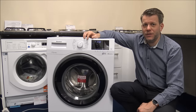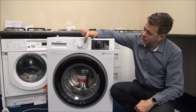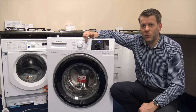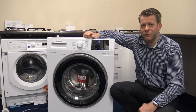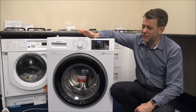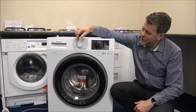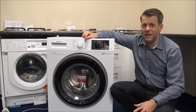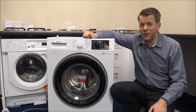The first perception of a quick wash is that it's going to use less water — and as far as this machine goes, that's definitely not the case. On this fast full load program that takes 28 minutes, if you're washing a full seven kilogram load on this particular machine, it will use around 66 litres of water. Nowadays that's actually quite a lot, especially for a quick wash. If you go up to the Eco program, you're looking at around 52 litres of water — so that's an instant saving of around 14 litres. If you multiply that by the number of washes you do over a week, month, year, several years, that's a lot of water.